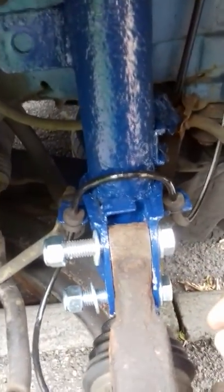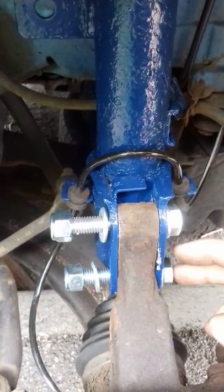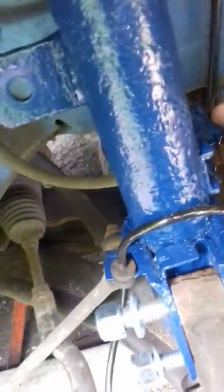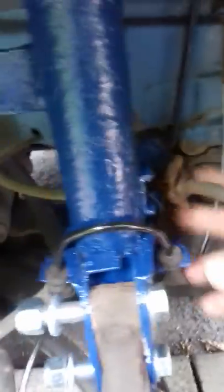Around at the bottom, a couple of bolts retain the shock absorber. You won't have clean bolts like mine — you'll have a rusted nightmare. I ended up getting the angle grinder out and grinding the ends of the studs flat on both sides, then punching them out. Avoid damaging the flat surface when you do that. Also be sure not to damage the ABS sensor, which is clipped in at one and two points and just pulls out, and the brake hose, which is retained with a clip.